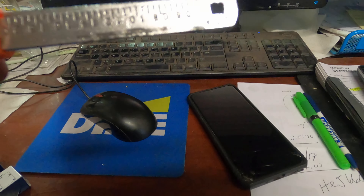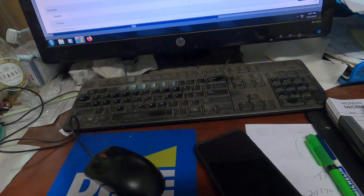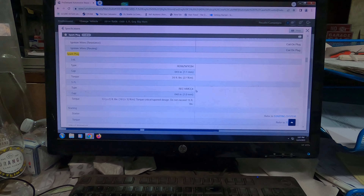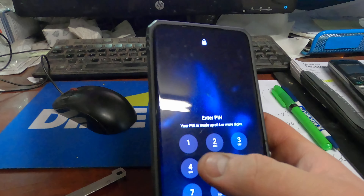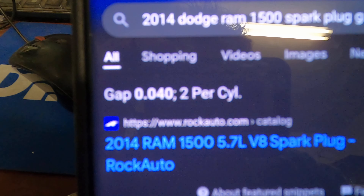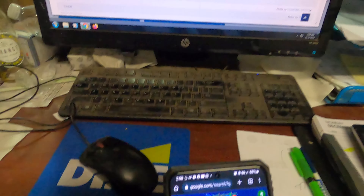On the gap tool we can see that if we go over to 1 - which is what the spec said - we flip it over and there's 40. Now I know what you're thinking: what if I don't have this program? I'm not going to go out and buy a program just to do one spark plug change on one car - makes no sense. Well, everyone's got a phone - you can go on Google. Put in the exact vehicle you've got and voilà: gap 0.040 for a Dodge Ram 1500 V8. So we know that adds up.